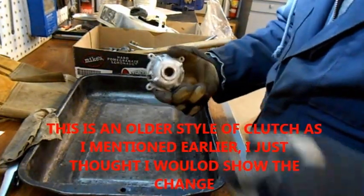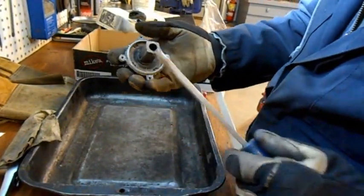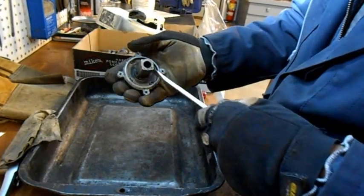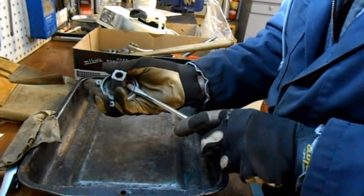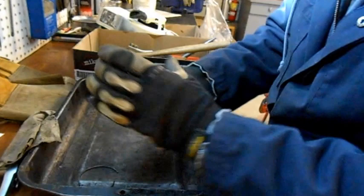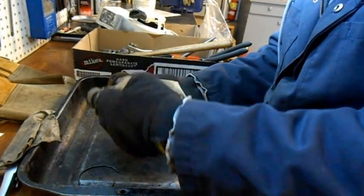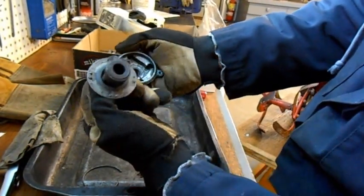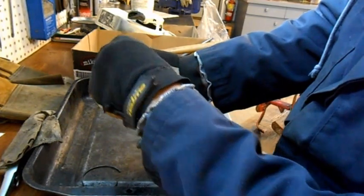Hello folks, I'm back. Here we have our 1961 clutch. I can tell it's a really old one because normally there are two pieces of metal that go together to hold this clutch in here, but this one has a clip — a huge clip — and it just pops out with a screwdriver like that. Now inside here is going to be some ball bearings that catch on some cogs. As it rotates, the ball bearings catch and it turns. So I'll take the lid off now. Well, look at that — there are four ball bearings in there with a little bit of grease, and there's only one cog. The modern ones have four or five cogs that catch the ball bearings as they go around, and it ratchets only in one direction.